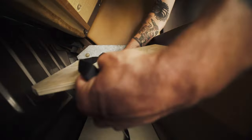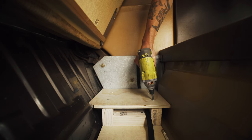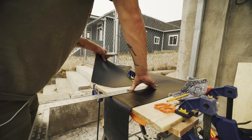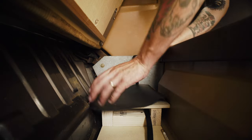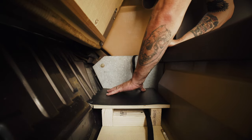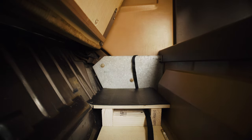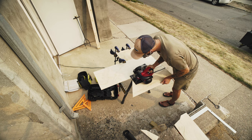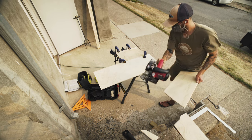When we were getting ready to replace the starter battery, we thought it might be time for an upgrade. We're somewhat limited in terms of space — the van is packed to the gills with everything we use. We have a lot of hobbies, so we had no free space to add a larger battery. We needed something that would fit in the stock compartment, and in the world of batteries there isn't all that much that fits there. After doing a bunch of research we decided that lithium iron phosphate — LiFePO4 — would be the way to go for us.